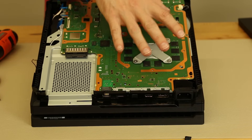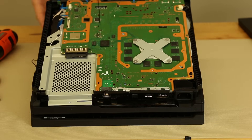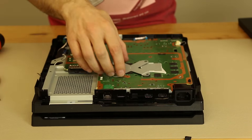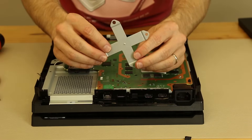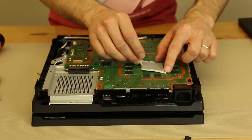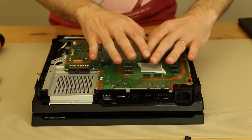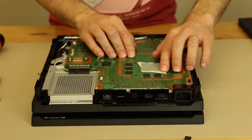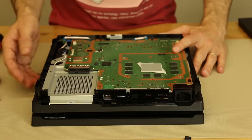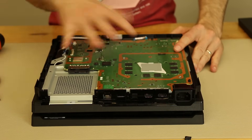So let's take the clamp off. We've got the clamp off, and there is also a spacer underneath. It actually catches pretty good right here, so I'm just gonna leave this on there and not try to pry it up — that could break the plastic. Then we're gonna flip it over, take the bottom off, get the power supply out, and then we should be able to get the motherboard out.